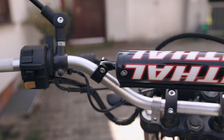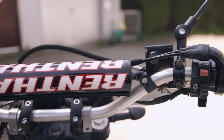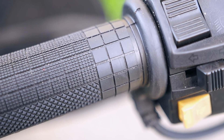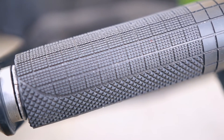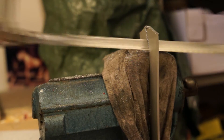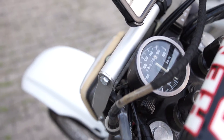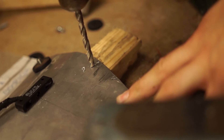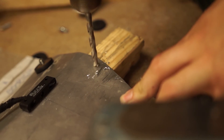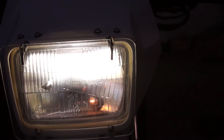I replaced the handlebar with a decent one that should not bend easily and also positions the grips higher than stock. As grips I chose Oxford Adventure heated grips that are directly connected to the battery. To find some space in the cockpit I fabricated my own aluminium mount to use my phone for navigation and fit a power socket. I improvised my own case savers and built my own license plate bracket from aluminium. I also fitted one of those Cree H4 light bulbs — I'll have to report back on them.